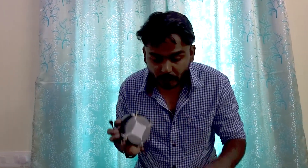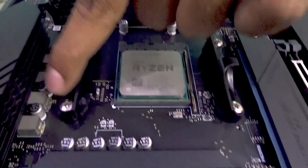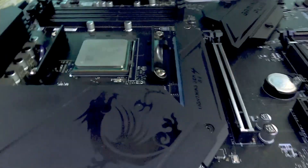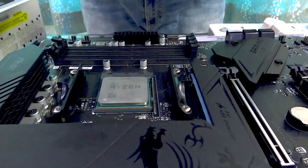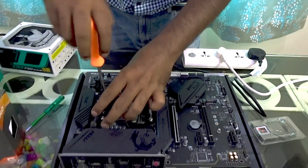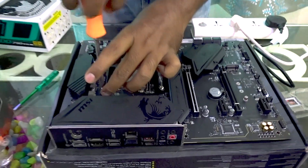You can see there are four screws on the stock cooler that will align with the four mounting points on the motherboard. However, you have to remove the stock socket bracket first, because the cooler will not seat properly with it in place. The reason you need to install the cooler is that without it, even in the BIOS you will get an error message that the CPU is overheating. Let's remove the socket bracket first.